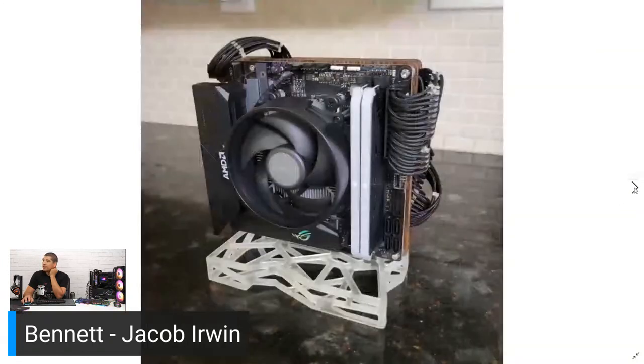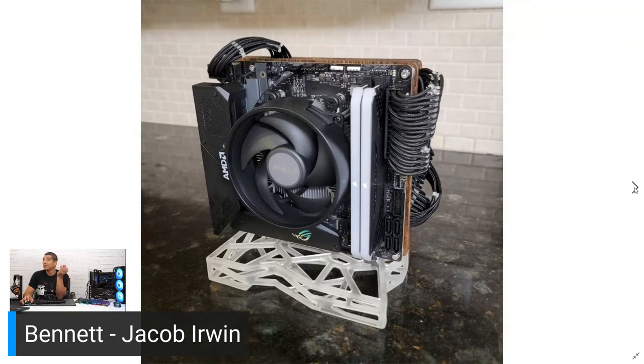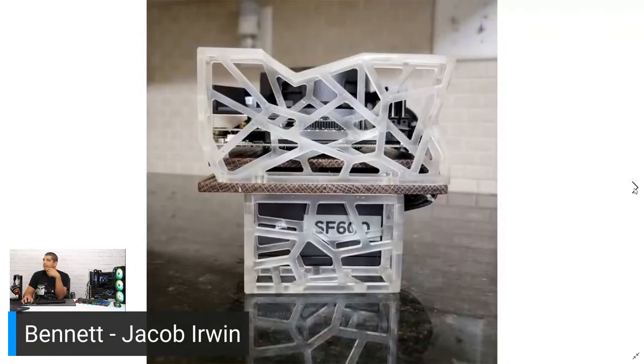It's really nice, just a true small form factor mini ITX based build. With a lot of people too, we make some really awesome mini PCs. This is a perfect example of that. You could still totally do a DIY system that is truly compact and would be faster than almost any real mini PC, because you don't have the wattage constriction that you have in so many mini PCs. A lot of mini PCs are generally going to be using somewhere between about a 6 to maybe 25, sometimes 30 watt class series CPU, although we have some that go up to 65 watts. Here you have full desktop class, so you're getting the full performance of the integrated graphics and of course the full desktop class performance from the CPU, right?